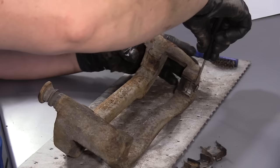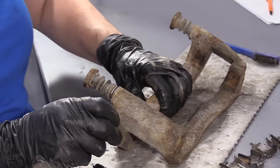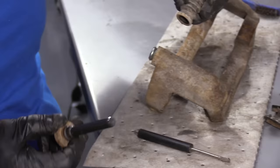It's where the pads ride on the bracket. And then we have the caliper sliding pins — we have the boots. See how I just pinched that, pulled that slider boot off — you just pinch the boot and slide it down. Same on this side.